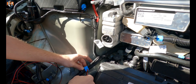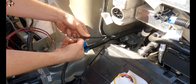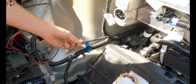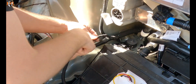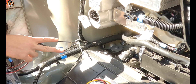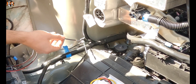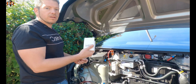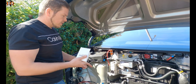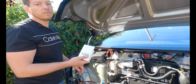What I'm going to do is take off this rubber piece and remove the protective covering. The two wires we're going to use are red with a blue stripe — which is the positive — and brown with a blue stripe — which is the ground. We're going to add an inline step-down converter for the Cybertruck to connect the light bars, just because the Cybertruck puts out 48 volts on these wires and we need to step that down to 12.